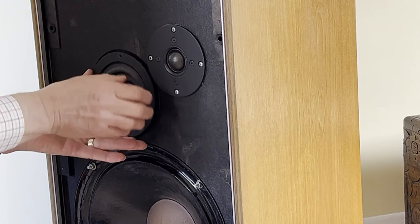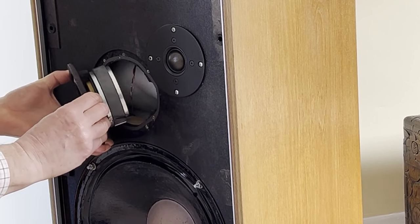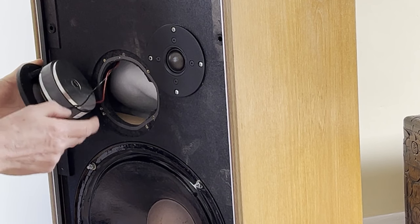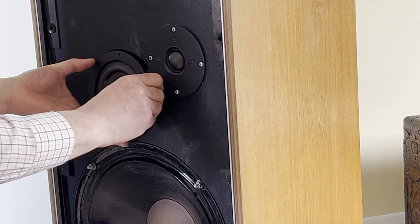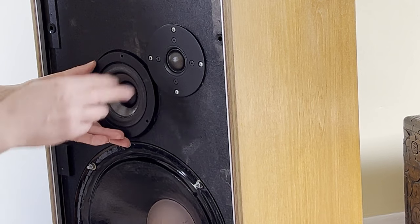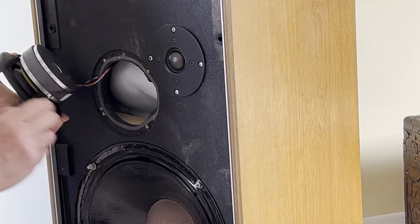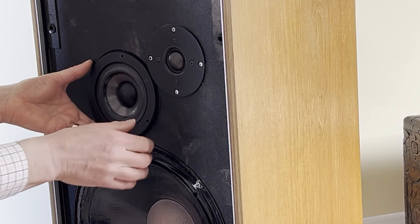As I take the mid-range unit out, I'll just ease it out. Here you can see the rear of the speaker with its large magnet, and then the cone on the front, along with the connections to the speaker. The new speaker dropped in very easily without the need for any woodwork, and the same was true for the tweeter. Around the hole I put some specialist foam tape, which is very fine and intended to give a good seal for the box around the speaker, as any air leakage can affect the bass response of the overall system.